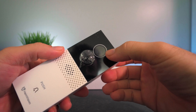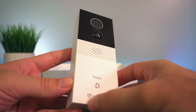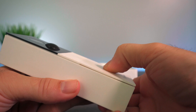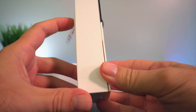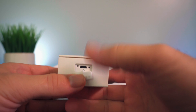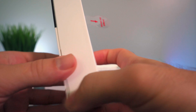Let's take a closer look. On the top we have the lens element with a plastic protective cover — I'll go ahead and pull that off. Below that we have the motion sensor. Here looks like the speaker, and down here this whole bottom section is a button — this is what you push to ring the doorbell. There's a little light here that glows. On the right side we have a mic. On the very bottom there's a port, specifically a micro USB port, and a little reset button to the right. The back says 5 volts, 1.2 amps.